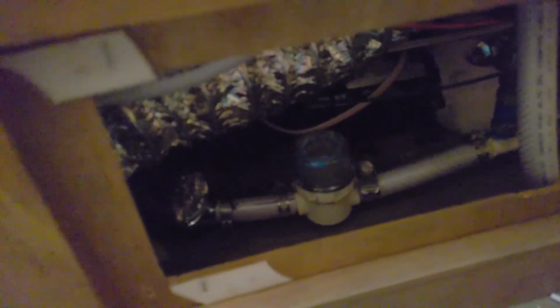Now, when you have a faulty check valve, the one big problem with that is when you're hooked into city water, the water will backfill your freshwater tank because it's allowing water to come back past the pump. So, there's a valve right here. Just simply turn that valve, and now it will not backflow when hooked into city water. What I'm going to do, instead of replacing this pump, which looks like a lot of fun, is put a SharkBite inline check valve in place.